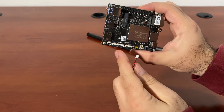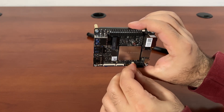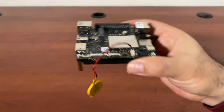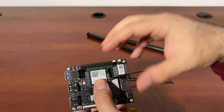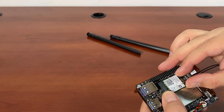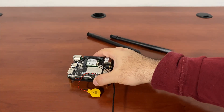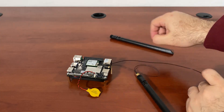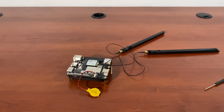You can add additional things such as the battery, UPS, and high-speed storage if you need it. There's only one way to insert the battery, so you won't have a hard time figuring it out. The two antenna cables are not connected when you get it, but they go in easily. Secure this with a screw. That's the Wi-Fi connection, and you can also attach these antennas — they go right here. That's pretty standard stuff, and now this is ready to go.